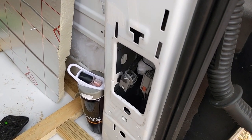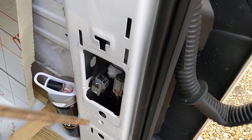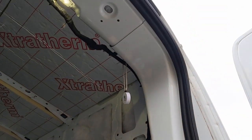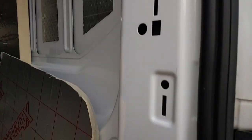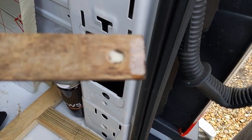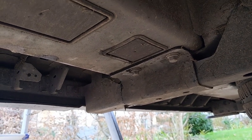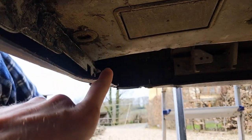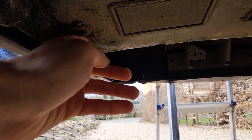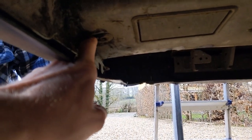While we're waiting for more Sikaflex to arrive, we're going to tackle this problem with this pillar. There's water pooling at the bottom, which we think is coming from one of the seals on the roof that's a little bit weak, travelling through the inside pillar and pooling in here. You can see there's a fair amount — about 5mm of water at the bottom. Abbie's climbing up onto the roof to find the source of the leak. Meanwhile I'm under the van trying to figure out how we can get that water out — and I found a little rubber plug here and it's just draining out nicely.